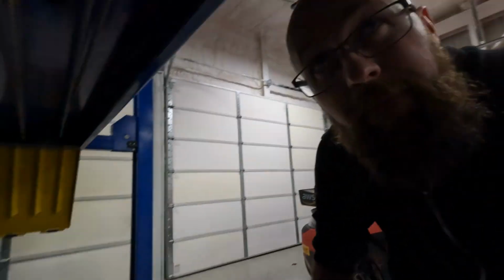All right, guys, so got the O2 sensor in there. It's got a little plastic catch, so I made a little notch in the heat shield and then ran the wire up over it. The connector is wedged in between the heat shield and the body, and then the wire stays behind the heat shield all the way up. So we'll go to the top and figure out our top routing, and see y'all in a second.